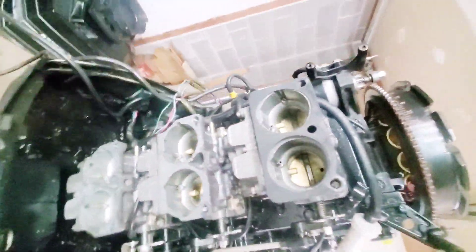Now I just have to pull the oil pump out and reroute all the fuel into the carburetors. I'm lifting the bolts and pulling the oil pump out. It's still connected to the fuel system, so I'll rectify that. I got the oil pump out with everything connected. Now I have to connect the fuel line directly into the fuel pump to feed it, which gets all the air and fuel into the carburetors. So I reroute the fuel line to go directly into the fuel pump.